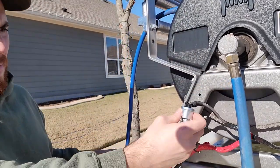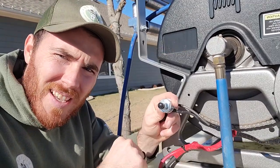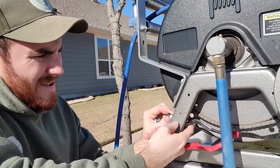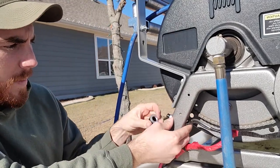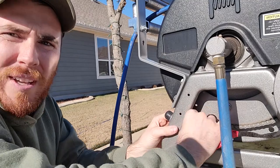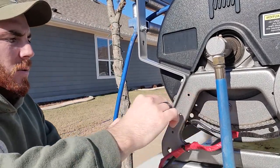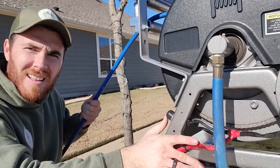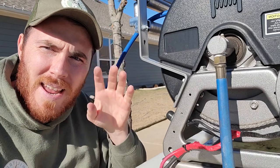As you can see, it's working great. To put it back in, the washer needs to go all the way down just like that, then you stick your button in. Make sure that your wires are away from this chain down here because that chain will rip it off, then twist your button on while holding these wires back to make sure they're not twisting. Once your button is good to go, hold your cable — it works great, and that's how you change the switch on your pump hose reel. Thanks and have a great day.